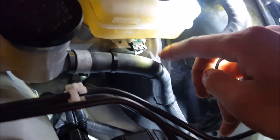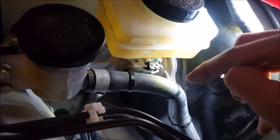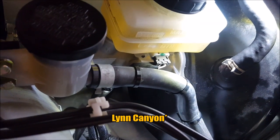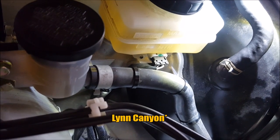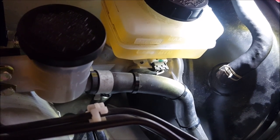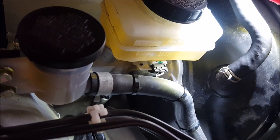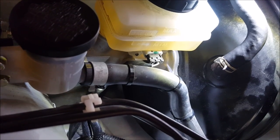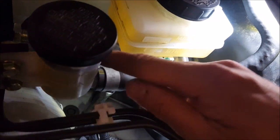So what I decided to do was take zip ties and go every inch and a half down the whole line. Yesterday I drove from Surrey to North Van — a good 45-minute drive — and I got stuck in traffic right before Mountain Highway, so I had to use the clutch quite a bit in the heat. That particular time I did not lose my clutch pedal, which I found interesting. I had also just topped off the fluid a little bit, but the circuit wasn't always low, so I'm mainly thinking it's the zip ties, since they have good tensile strength and aren't allowing the line to expand.